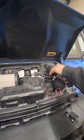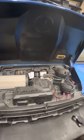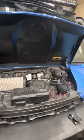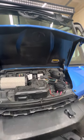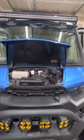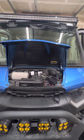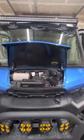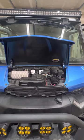The next thing I installed is a backup module from Sam's Backup Lights. Shout out to Jake over there for helping me diagnose a problem I had with it on the weekend — we got it all figured out, super simple. If you're looking for a backup module that will control your reverse lights just by using the stock shifter, without a separate rocker switch, this works by tying into the data connector. As you shift from park into reverse, it activates the lights in the back.